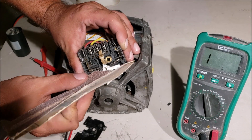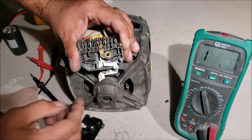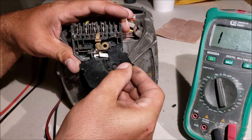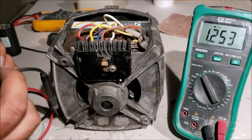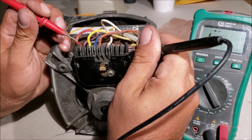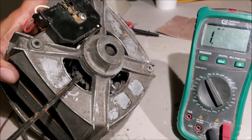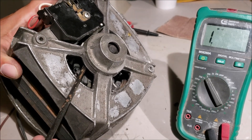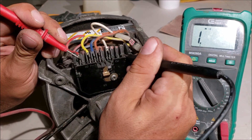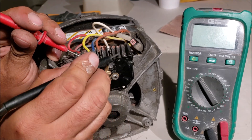When you're in here messing with the switch, take some sandpaper — probably finer grit — and just clean those contact points off to make sure they're working, because they do get dirty. Cleaning the contacts is very important. Now we put the meter on the diode with continuity — no resistance. When we touch these two terminals we should have no resistance, and we do. Then we push that little wheel back so the switch should be open, and we should get nothing when we check these two terminals — confirming the centrifugal switch is working.